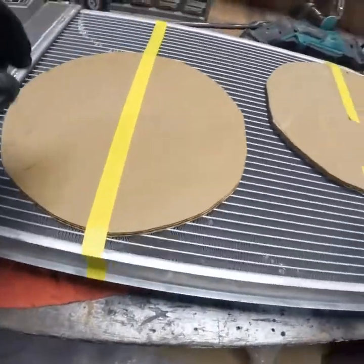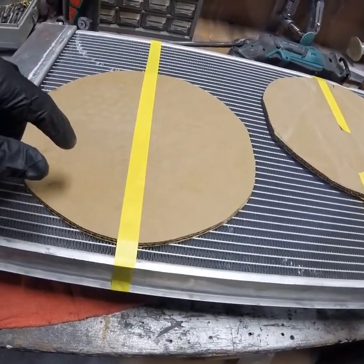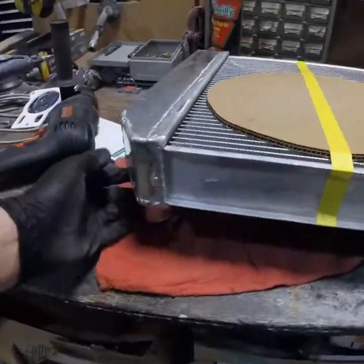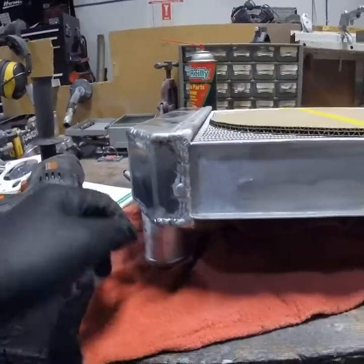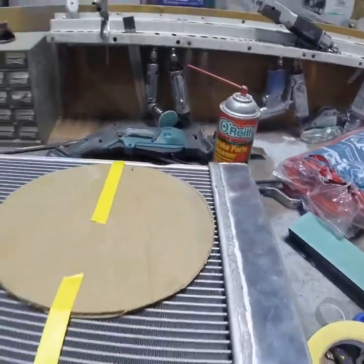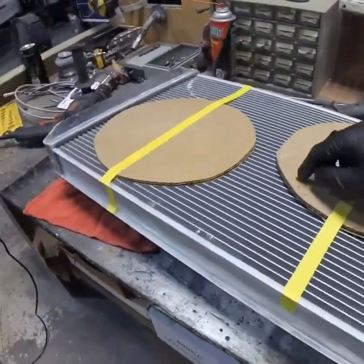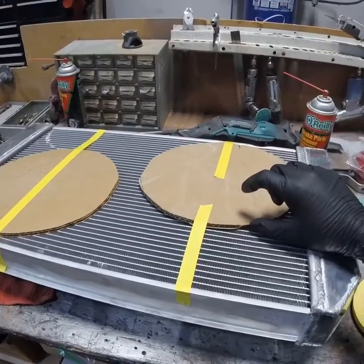Right here are templates for a 10-inch fan. The overall diameter of the 10-inch fans I'm looking at are 10 and 3/4 inches - that's the overall diameter. I got it on the same side as the inlet and outlet, so where the coolant's coming out the fan is right there cooling both sides. These are 10 and 3/4, that's the overall diameter, and the overall thickness is two and a half inches - 2.56, so pretty much two and a half inches.